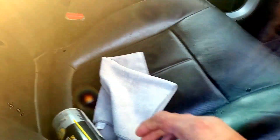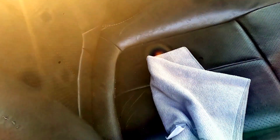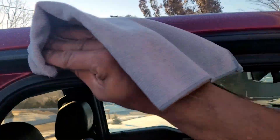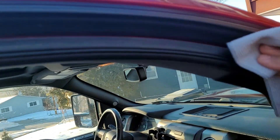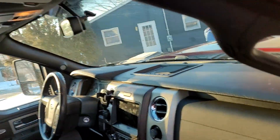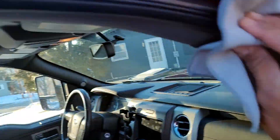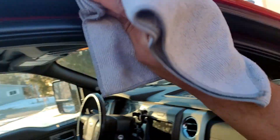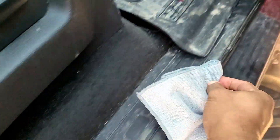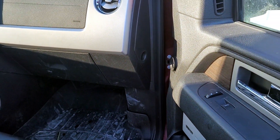To make sure that doesn't happen, get yourself some silicone spray and a microfiber cloth. Get that cloth going, take the silicone, and wipe it all down — spread it on there nice on every part of the seal. We've got this inner seal and this outer seal, so go ahead and get a nice coating everywhere on there. The seal goes all the way down the sides too, so take care of all that. Get it nice and coated and that'll stop that moisture barrier from forming on your door jamb.